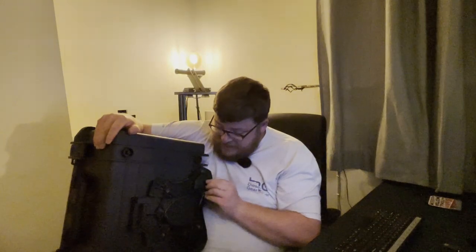If I had to do this again, I'd make this base plate a bit bigger. I'd make this all out of PETG, which I might do when this needs to be refitted. But make this base plate just a little bit bigger so that it clamps in a bit better. And I'd put a penny washer here just to distribute load on this clamp a bit more.